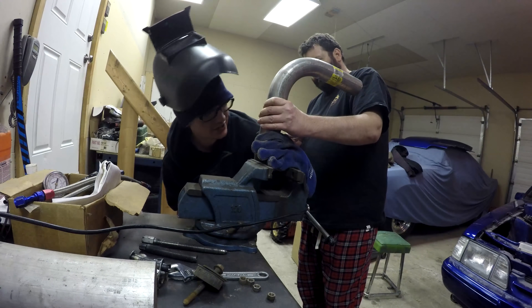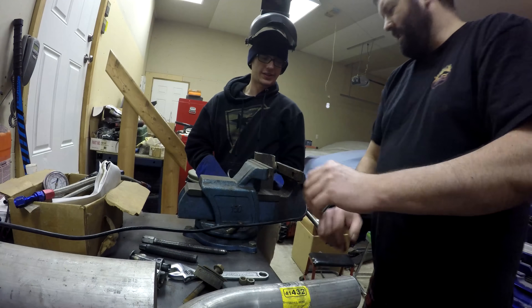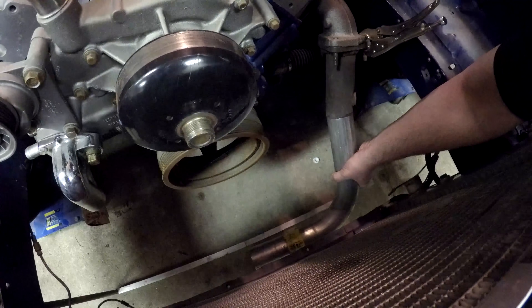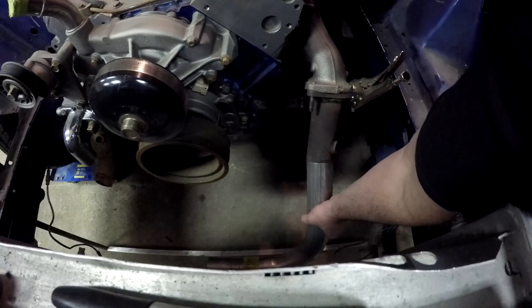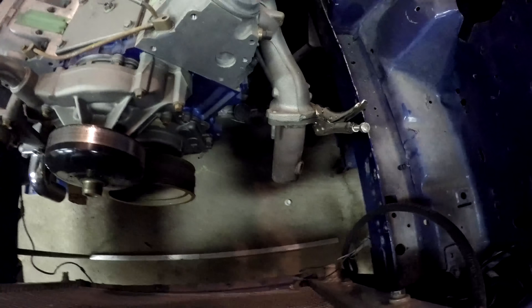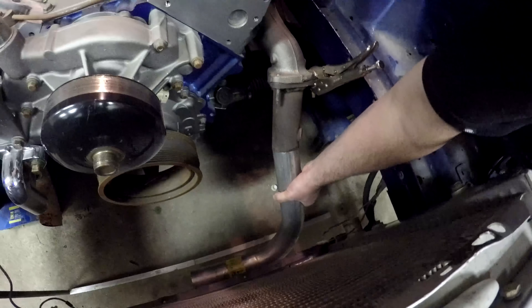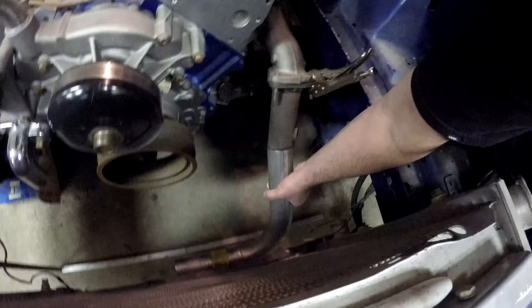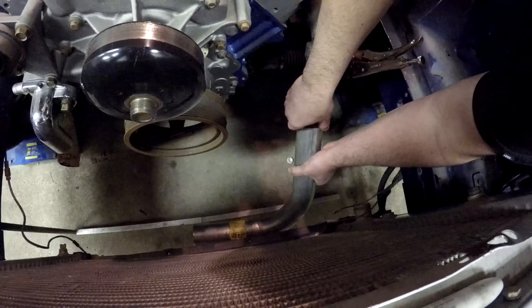You can almost TIG weld this thing guys — that was just by eye. Pretty good. Let's put this in the car and see how the angle is. That's not the prettiest angle, but the way you'd fix that is not using this piece of cutoff flange with the O2 sensor. We could cut it up higher to save money on a bung — basically that's what we're doing here. That doesn't look too bad at all, especially once it's wrapped. The angle's pretty good.